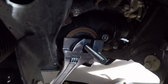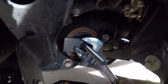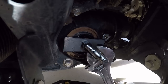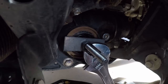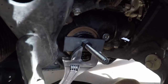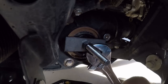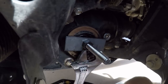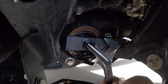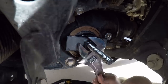As you keep cranking, note that the axle seal is just inside there and you can replace it if you want. This tool doesn't really damage the seal at all. I have an axle seal on hand but since the truck is fairly new I'm not going to change it right now. Once the needle bearing is out and the bushing is installed, you can replace the axle seal if you want — a lot of people recommend doing it while you're in there.